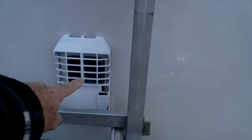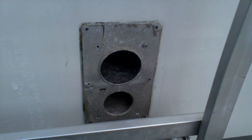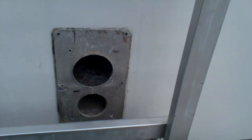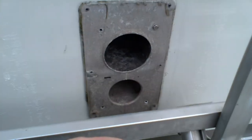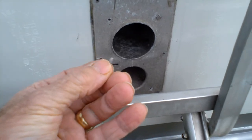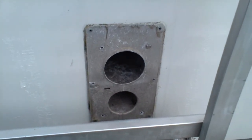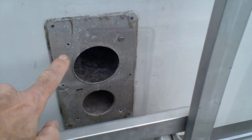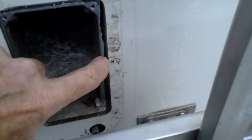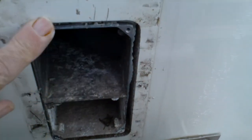First thing to do is remove the cowling, so I'll get that done and see what's underneath. After you've removed the six screws that secure the plastic cover, you've then got this behind - but be careful, because they use these screws threaded into the aluminium and they just strip. So be very, very careful when you try and crack these open. Remove the cover. Once the cover is removed, you've then got to dig out all the silicon that secures this to the side of the van to prevent any water ingress.